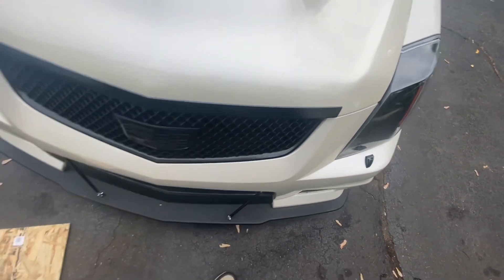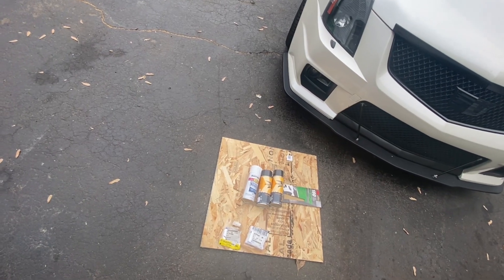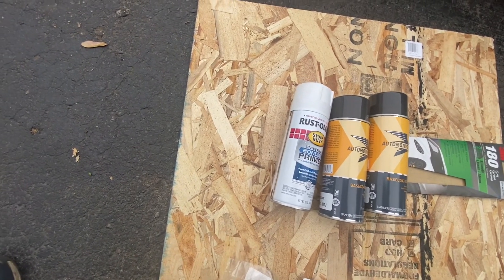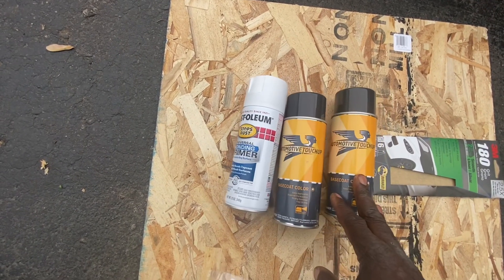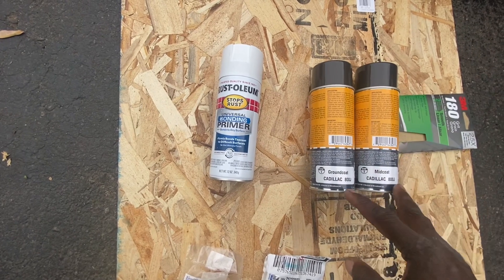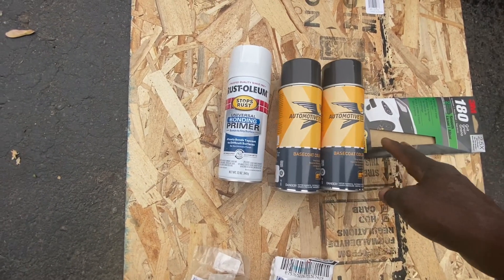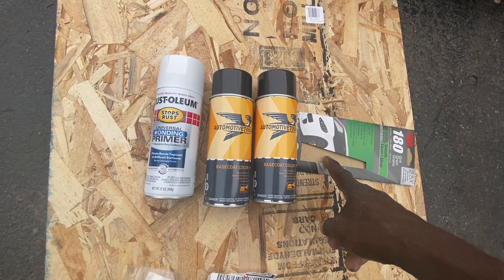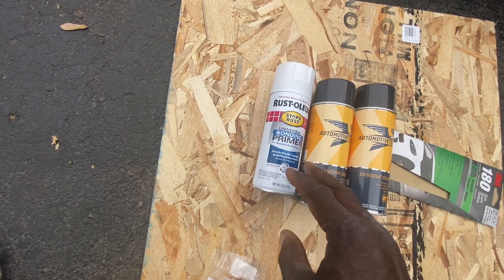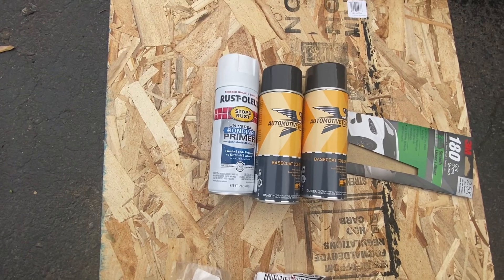Today I'm going to paint these because I ordered them a while back, but I also had to order the paint and the paint took a long time to get in. I have my white primer — I'm painting it white to cover up the black. I ordered this from Automotive Touch-Up; they do a great job of color matching. This is the white diamond pearl, which has two different coats: the ground coat and the mid coat, and of course a clear coat finish. I'll scuff the pieces, apply primer, sand lightly, then do the ground coat, mid coat, and about an hour later the clear coat.